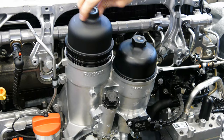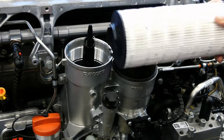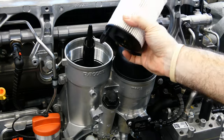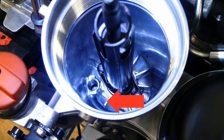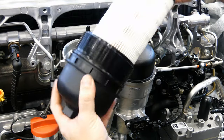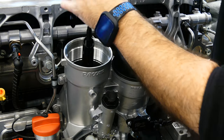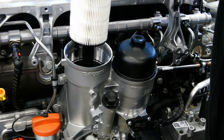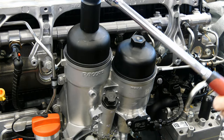The secondary or main engine fuel filter is removed the same way — grab, pull, and twist to the right to separate. Again there is a dowel on the filter so make sure it is aligned correctly as well before reinstalling. Push the filter into the cap and spin to the left to lock it into place. Align the dowel, then tighten the cap. Make sure you torque them to spec when you're done.